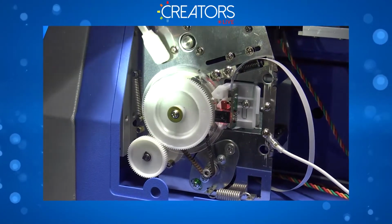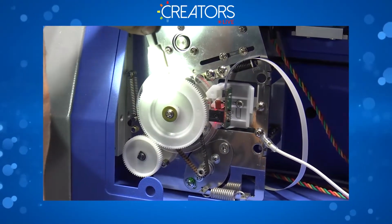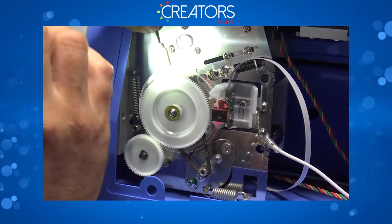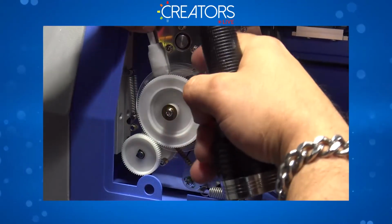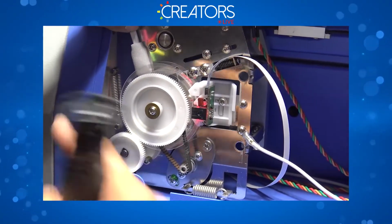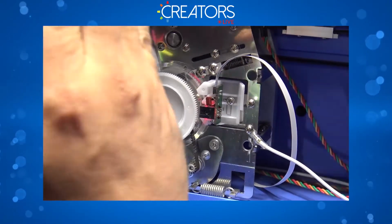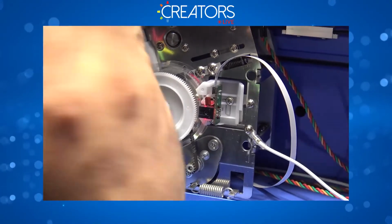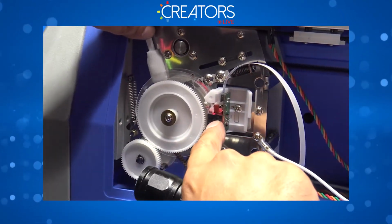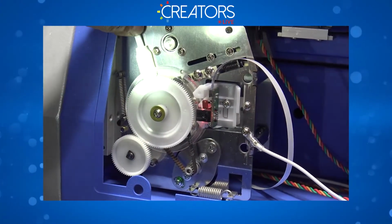All right, so I like to press it against the plate, then I will slide it underneath that disc. Notice that I'm not releasing pressure because I don't want to bend this plate towards me or out. Otherwise, it will become bent, and when it starts spinning, it's going to do this. And that's exactly what we don't want, because otherwise it's going to be rubbing against the sensor, and you will end up getting an error.